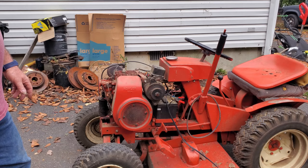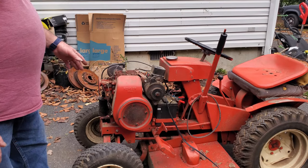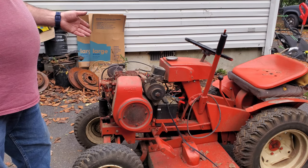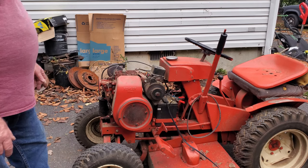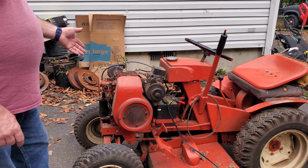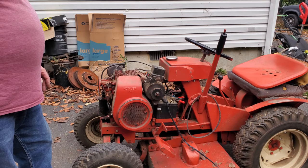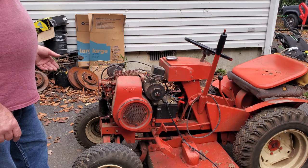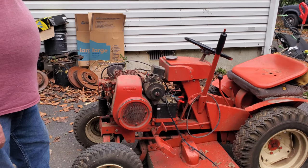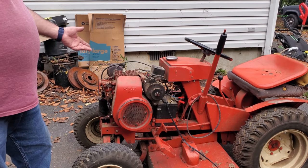The pump is probably bad from sitting — the diaphragm probably is not good. Then you would check the carburetor. I'm not going to take the carburetor apart — it runs, that was the whole goal here, just to see if it runs. There's a good chance the carburetor would get replaced if it needed any work, because till you take it all apart and order a kit and put it back together, hopefully it doesn't leak. Maybe you need a float — I don't know if these floats are even available anymore. That's probably brass and it might be corroded through. But getting the carburetor working once you get fuel to it, you could probably run this thing around — fix the wiring, put a good battery in it, and it's a nice little piece to ride around your yard or take to a parade.